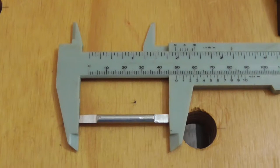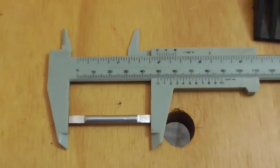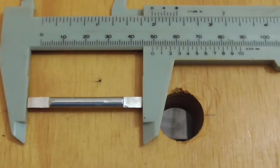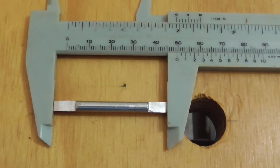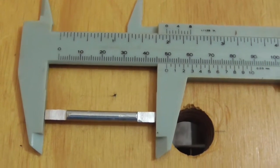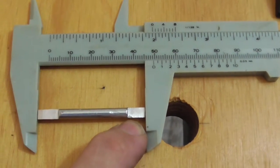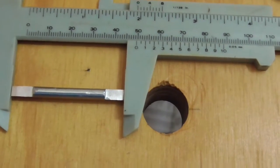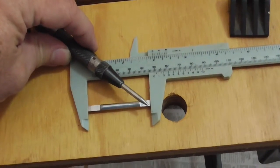Here's the part with one side filed - it's pretty even, probably within a couple of degrees. The part is just under 50 millimeters long - 49 and change. The distance between the two holes I measured comes in at 45 millimeters, maybe a tad less. That means I need to go about 2.5 millimeters in from one end, put a hole there, then come up 45 millimeters and put another hole. I'm going to use my center punch to mark where the drill is going to go.